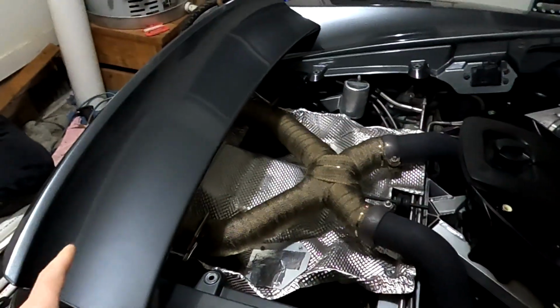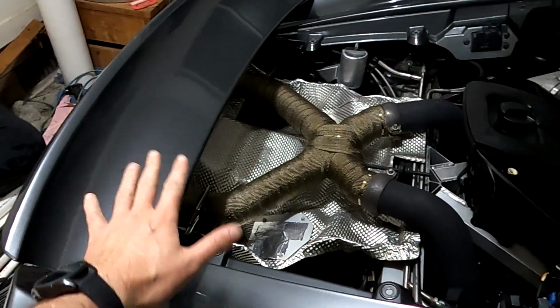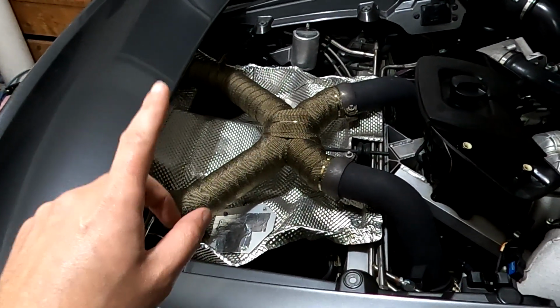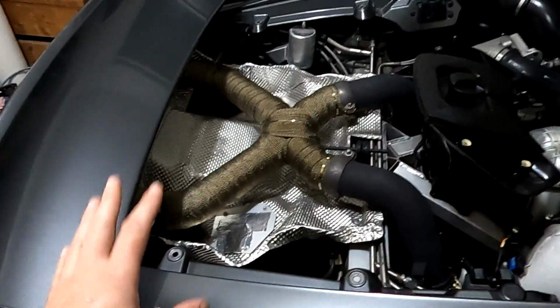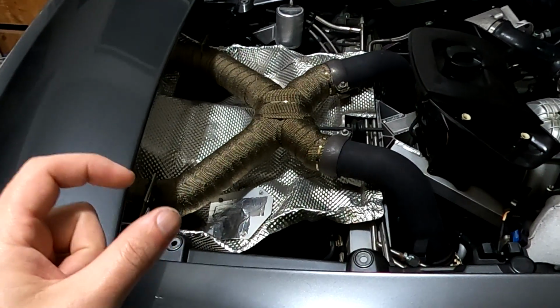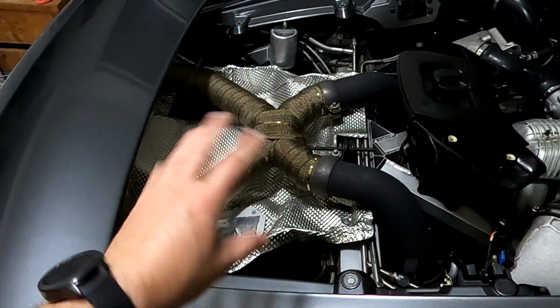And here we go. This is what I've got. Everything's still apart. I do have the air brake on, so I can do a test drive. I have already done a very quick short one, to make sure everything was good. There were no pops, cracks, bangs, anything like that. I'm going to do another test drive doing an audio analysis and make sure that the small resonance that I heard, it's gotten a lot better, a whole lot better, but it's still there just a little bit. So that resonant frequency should have dropped a little bit. So I'm going to check that, make sure what that is, validate that against my calculations.